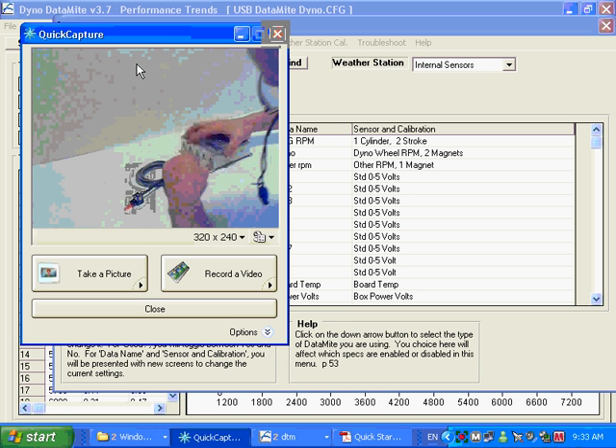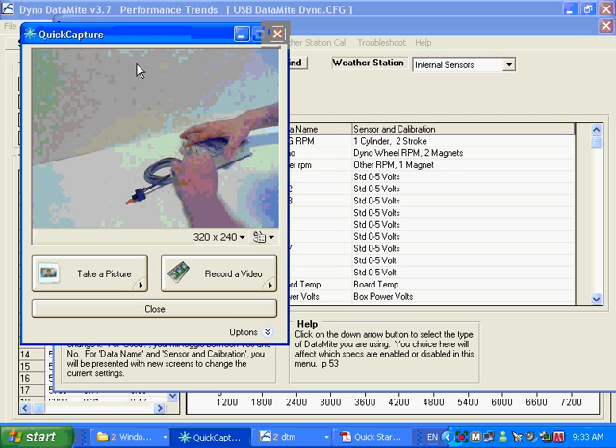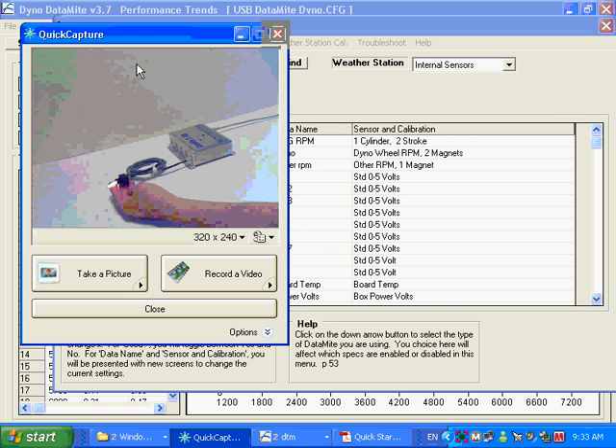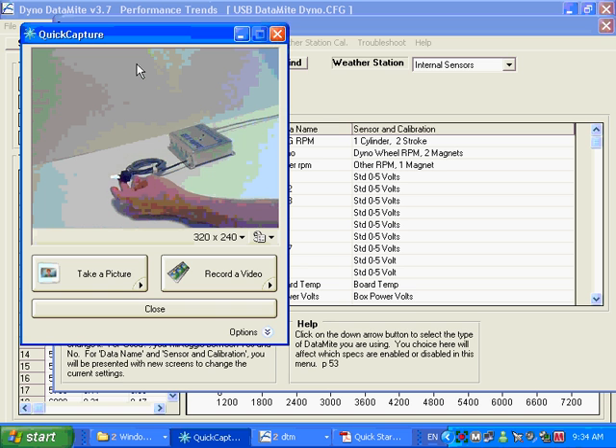Instead of a direct connection, you'll have a toggle switch in the car as a recording switch. When you see the light on, you know it has power. When you see it flashing, it means it's in standby mode and ready to record. Flip the switch up and it starts recording. It will record until the SD card segment is full or until you turn it off. The SD card has huge memory, so you'll probably never fill up a segment — realistically, it records until you switch it back off.